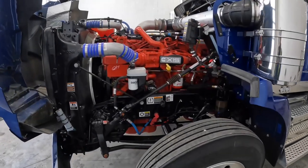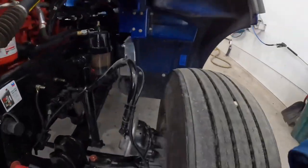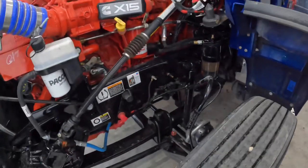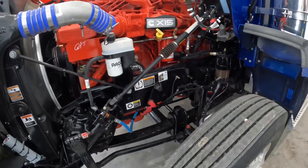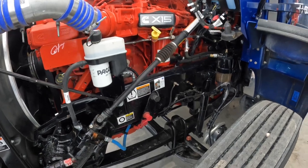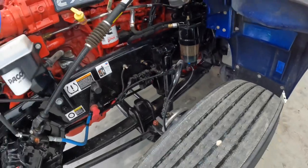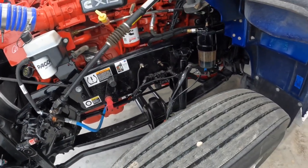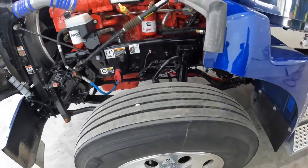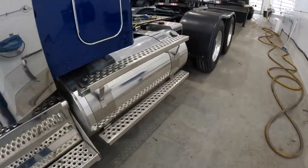Keeping parts the same and everything else. I went with disc brakes — they're supposed to last longer. We have a 2014 Kenworth with disc brakes, it's got close to a million kilometers on it and they are the original disc brakes that haven't been touched, which is pretty impressive. With disc brakes there's not a lot of greasing to be done on this truck — I'm not seeing many grease nipples.